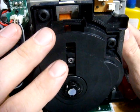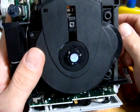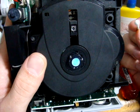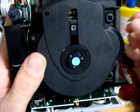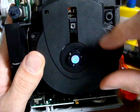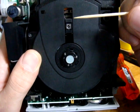This takes a lot of time. I've gotten it down to the point where I know just about what angle each of these lenses has to be at and how perfectly aligned they have to be, so I can do it quicker than someone doing this for the first time. But it is an option and I want to share it with those willing to try. Just reset and reposition the lens, then use the q-tip to push it back down once you get it in the perfect position and it's actually reading your disc.